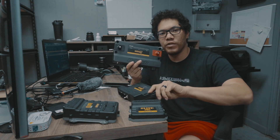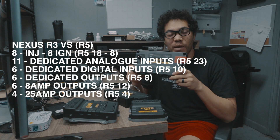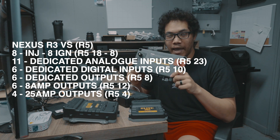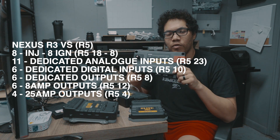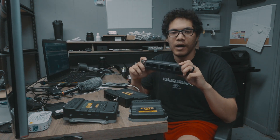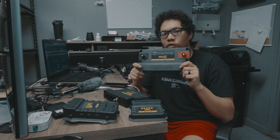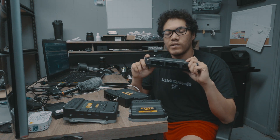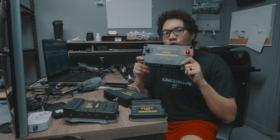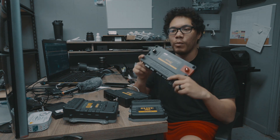The R3 and R5 both have all the same features as the S2/S3 — the only difference is the included PDM. The R3 has four 25-amp high-current outputs and about 11–12 additional outputs. The R5 has twelve 8-amp half-bridge outputs. The R3 is essentially equivalent to an S3 with a PDM built in, and the R5 is a completely different beast. If you're building a car from scratch, all your wires can come from this one unit — brake lights, headlights, starter control, everything — back to the ECU, and you can monitor what each wire is doing individually.